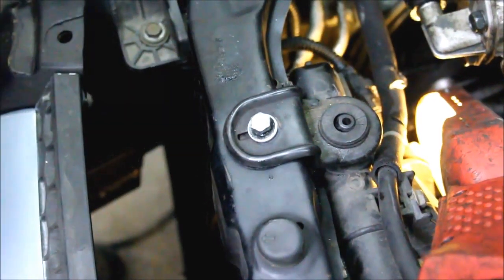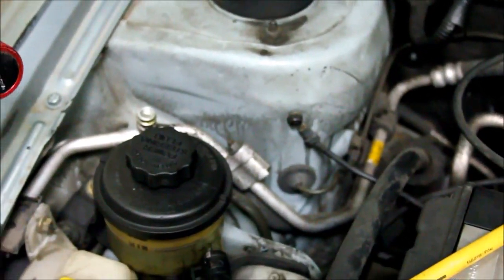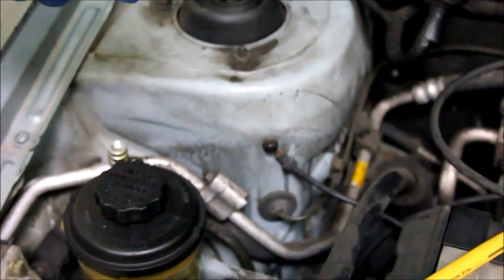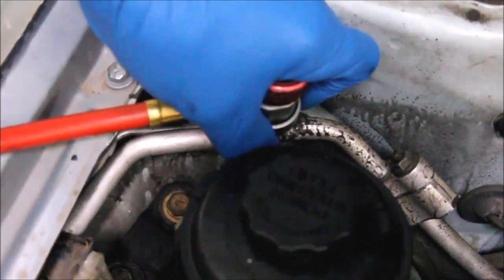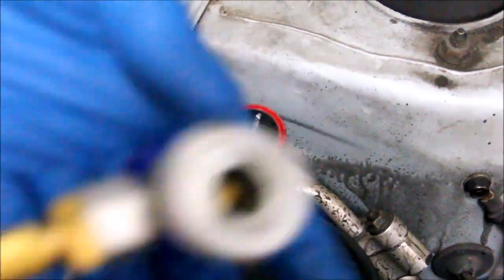Tighten it up and we'll be ready to vacuum test the AC system. Next step is to attach a gauge set — there are two ports, high pressure and low pressure. If you don't own one of these you can buy one; they're relatively inexpensive and available online, or you can rent one at a local parts house — they basically let you return it without any charge, so you get to rent it for free. There's a small Schrader valve inside, similar to what you'd find on a bicycle tire. The quick connector goes into place, then just turn it down gently enough to open the Schrader valve. Same with the other one — snap it into place and open the Schrader valve gently. Don't bend it or break it; it's delicate.